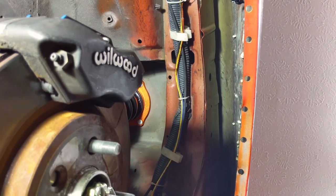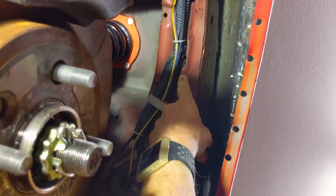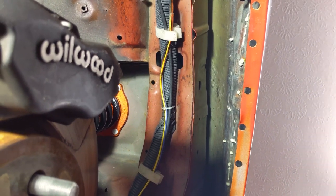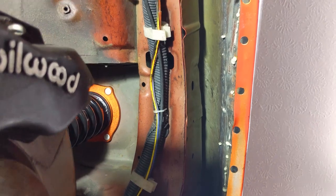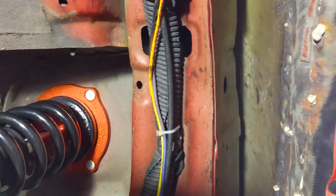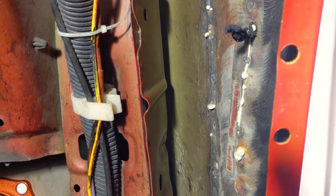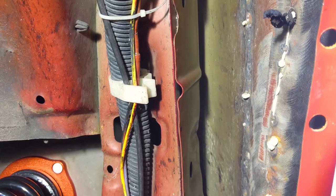I had to take the wheel back off again. The reason is we need to bend down this flange here because we've shortened the suspension to the point where the tire may get sliced on that flange when the spring compresses. So we're going to bend it over and try to flatten it out so we're not slicing the tire. I'm going to get started on that right now.